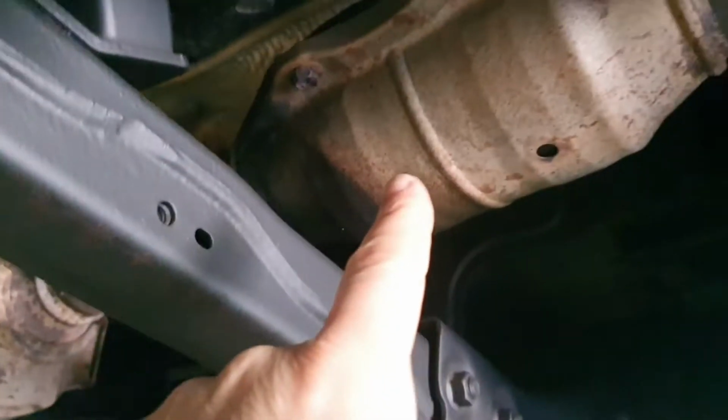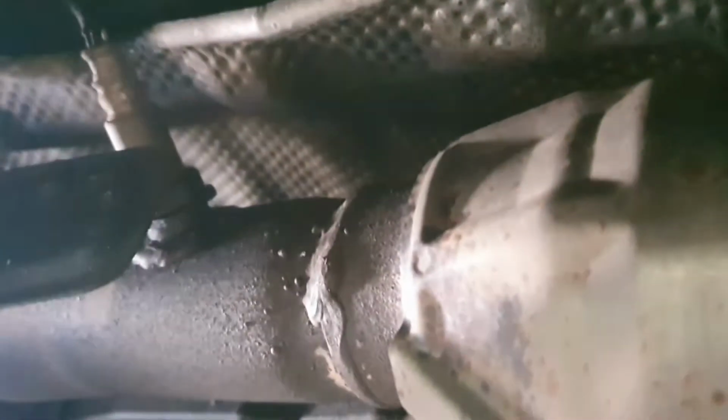From there we've got 4 catalytic converters on this car. Primary, secondary catalytic converters, same on each side. It's those guys there. We have 4 O2 sensors. Some of them are doing more than others. That's your primary O2. We'll come back here to our secondary O2. The primary O2 itself is what trims your fuel. This one here is actually more looking at your cat converter condition. So we'll have to do something to trick that.